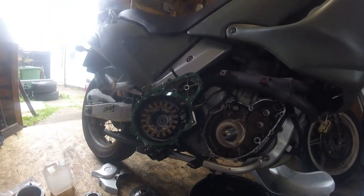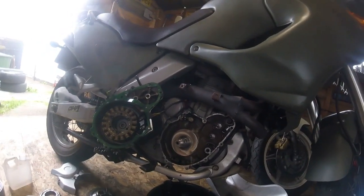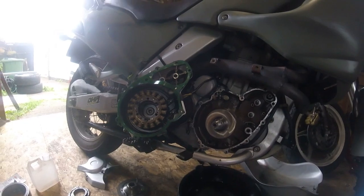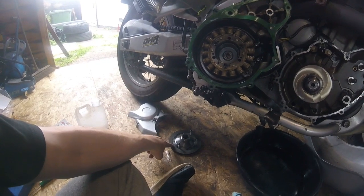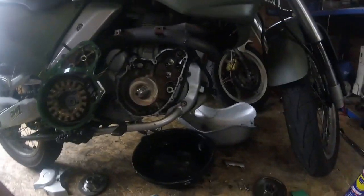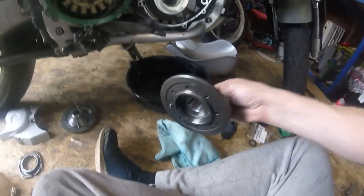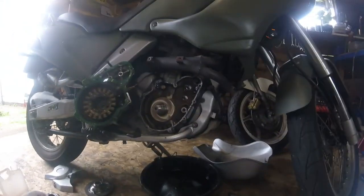Now, like I say, I've been on the forums and I've been reading up about these. It was specifically about the other Aprilia single, not the Yamaha engine, the other Rotax, and they're all pretty much a commonality of design. That is the original Aprilia flywheel base, which I've now got to bolt the sprag and the stator on. This is the one, the brand new one that I put on when I replaced the sprag. Now you can see the damage in there, look. But hang on, let me rest you on my beautiful knee, and I'll show you something. The taper should make it a snug fit.